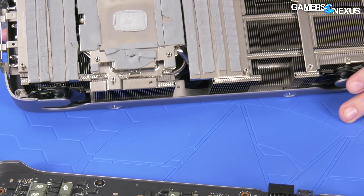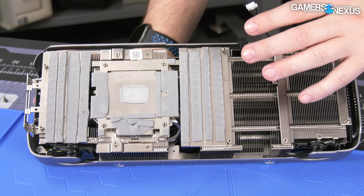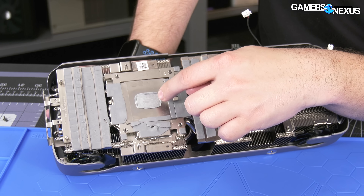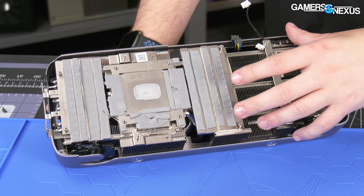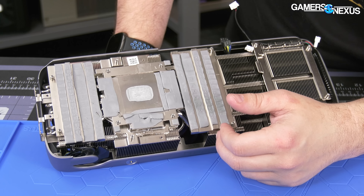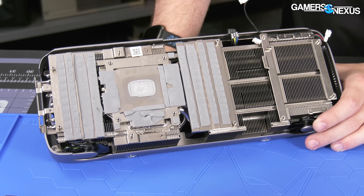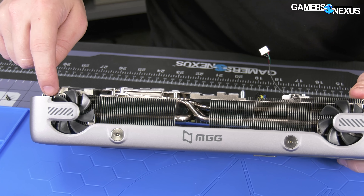For the rest of the cooler — a lot of plates, huge amount of thermal pads, they went insane. This is something we've talked about in the past: when you start sinking more things to the same heatsink, it has the effect of making the GPU core appear hotter when in fact everything else is just cooler. The core is now sharing a heatsink with all these other components, more than you would typically see synced — for example, compared to the FE card. Because of that sharing, it is going to make the GPU appear thermally worse, but it's still more than acceptable.